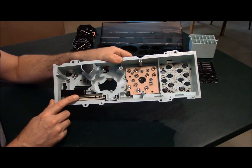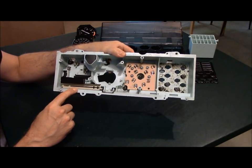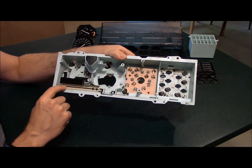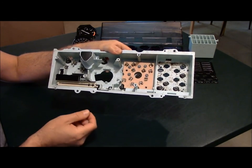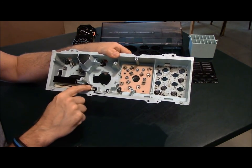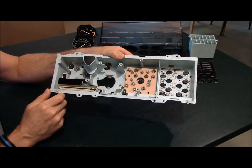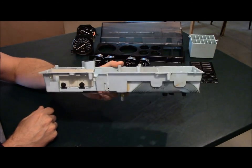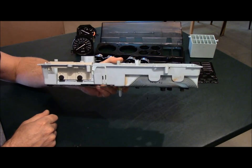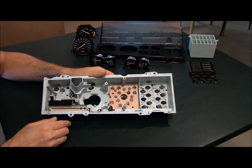On a non-center-console car this is the Prindle. You can see they just made one cluster — either you've got the Prindle printed on here, or it's blacked out like mine because it's a center console. Here's the slider, and there would be a cable underneath that hooks to the steering column — as you went through the gears the cable would tighten up and the indicator would move over. My indicator is down on the center console so I don't need it. If you do need to remove it, there are two 7mm screws on the bottom. We have the joy of our cars being metric and standard mix depending on what you're messing with.